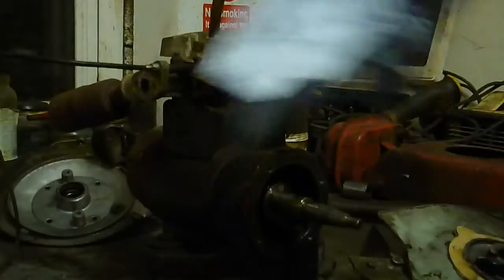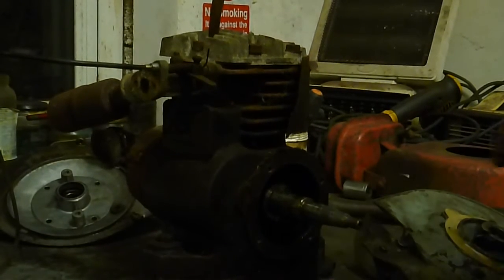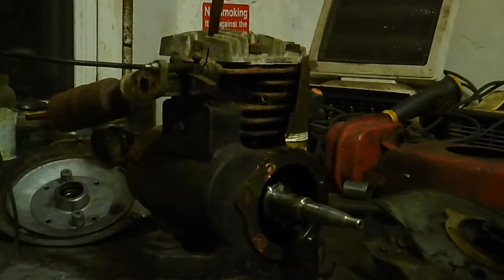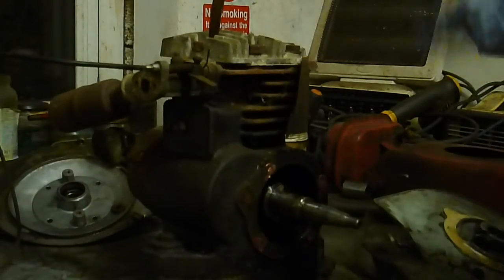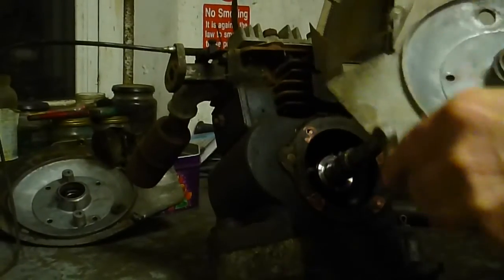There you have to line it all out. Don't forget to put the crank washer on. When you make videos, just be careful and don't forget — because you're talking to yourself, you tend to forget things. So we've got the grease — that's copper grease. I'll just do some copper grease — that comes on all along that. There's no oil in the engine, so I'm going to go out and blend it.